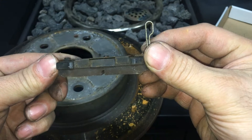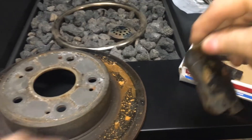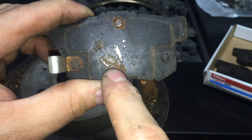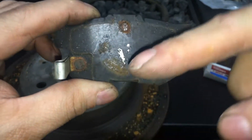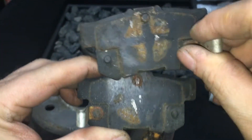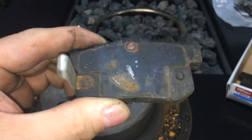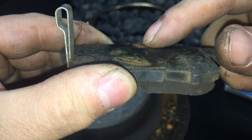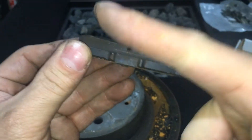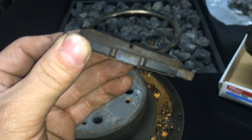See that — nice and smooth. Now here is what it looks like when it's installed wrong. Notice that your only rust mark is right there, and the piston was turned this way. The piston was turned this way, and your pin is crushed — crushed. And look at the pads — the pads are worn this way.